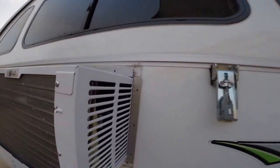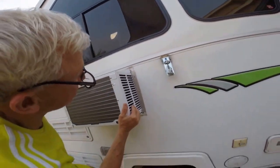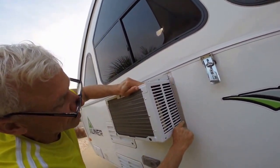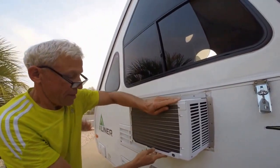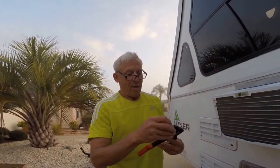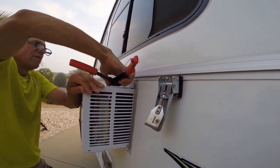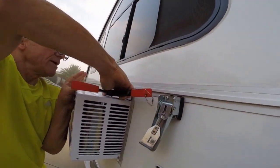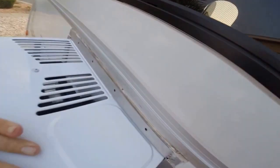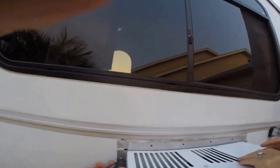The unit goes in and these holes all line up, but over here they're off — whoever riveted on the bracket was just a little bit different. I'll have to send my 3/16th drill through and then let that hang there, then take the pop rivet tool and put the rivet in. I'm having a little bit of trouble getting that lined up, so I'll put in the ones that fit first and start pop riveting, then line up the other ones.